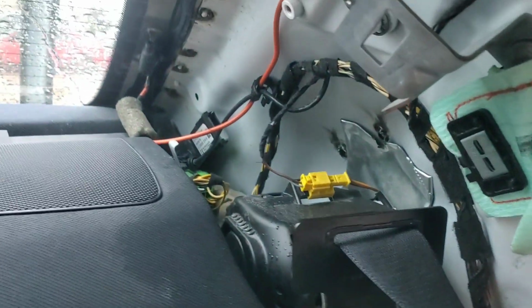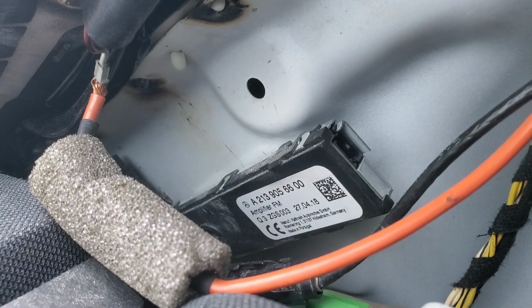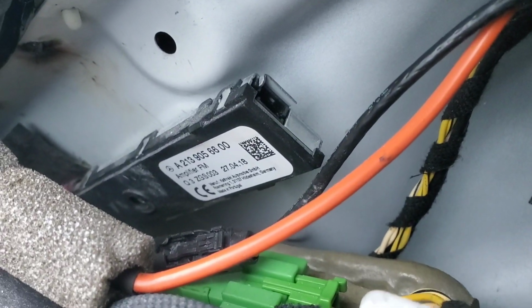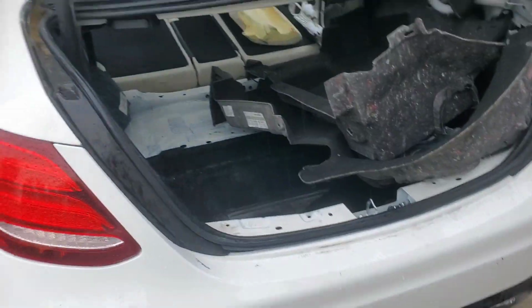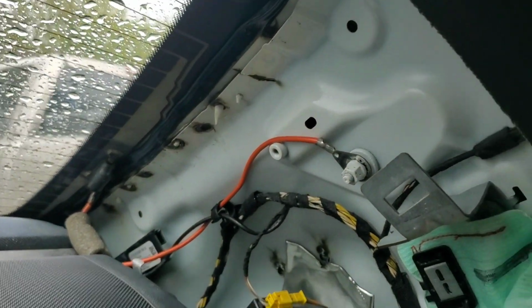This is, of course, the quarter panel they changed. And I don't know if you guys noticed anything yet. I noticed something. Look at that. Plug missing. That's the FM amplifier for the system. I believe would be A2/32. By the way, there's a leak here, so it's actually leaking rain. Looks like the glue came out of place when they were drying. They did have to remove the windshield because they replaced this quarter panel.